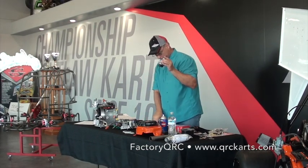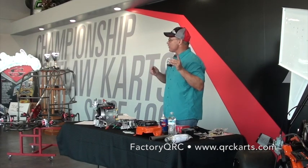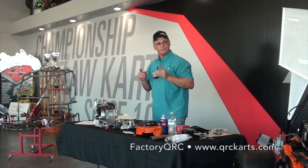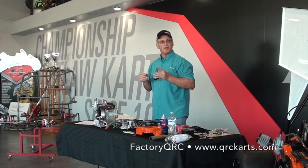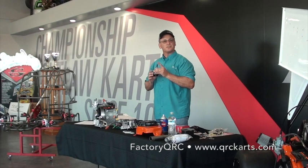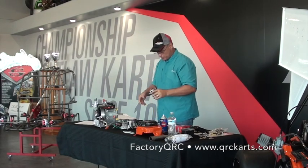So there's our float — set at 880 or closer to 900 for the green slide. Even for the black slide, if you guys want to go to 900 and experiment, you'll probably see a gain, especially with a 15-degree mount. The bigger the angle, probably the greater the float. Experiment — maybe your engine wants to be at 890, 880, or 900. Play with it a little and see where the sweet spot is. When you find that sweet spot with the alcohol motor as an example, it runs perfectly.